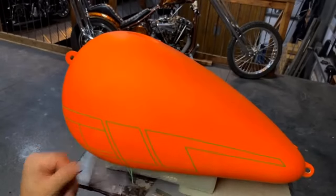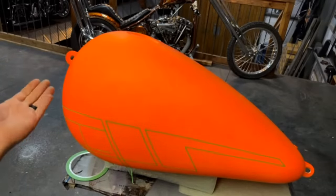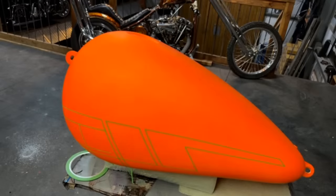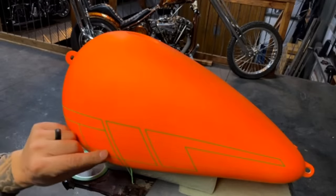Is the pigment a matte finish? It's been coated with clear coat and sanded, so it's matte right now, but it's actually gloss clear coat on top. When everything's all said and done I will be spraying a matte clear coat over the top. If you want a satin or matte finish rather than gloss, it's all in the clear coat — you just want to buy satin clear coat. The pigment itself won't determine the finish; it needs to be top coated with something.